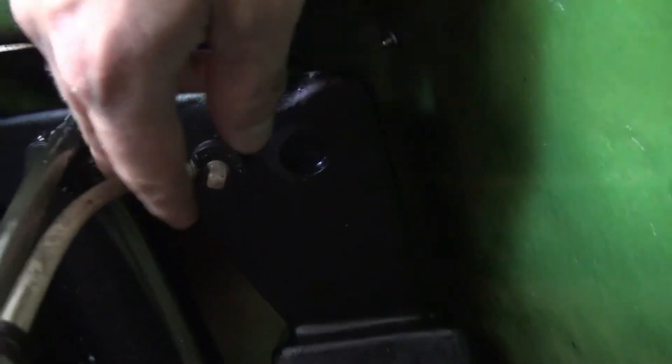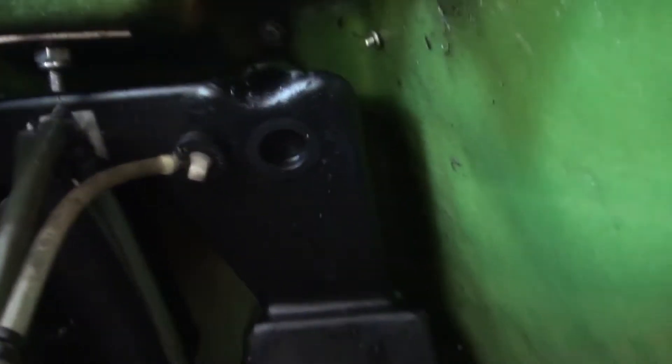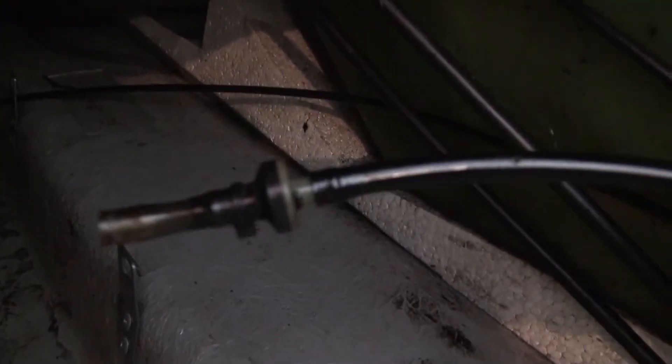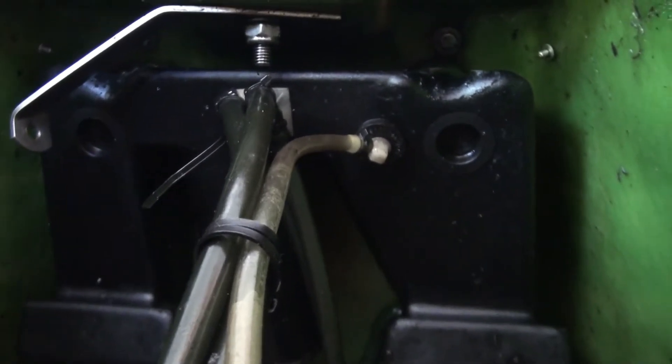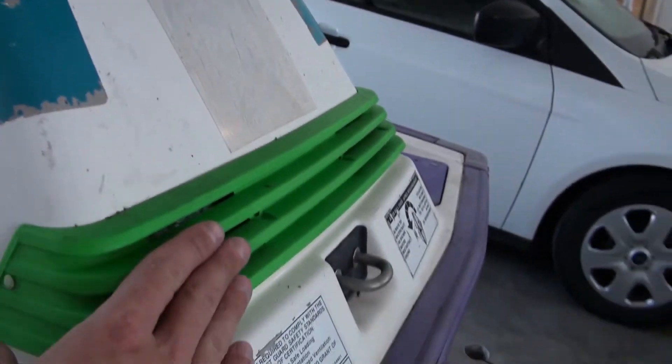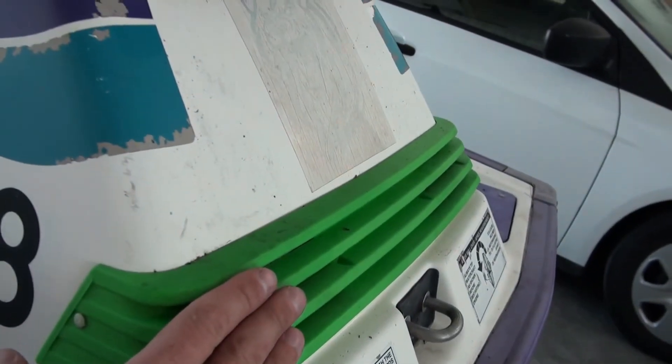At the highest point here we have another tube that's actually broken — I've got to fix that. That tube actually hooks to the oil reservoir. And that makes it so that the oil reservoir doesn't get locked up. So the oil reservoir actually breathes through this little tube here, through this air dam. It's very important that this is not permanently obstructed — that's actually how the oil reservoir breathes, which is really interesting.